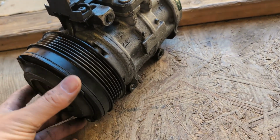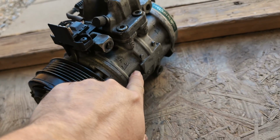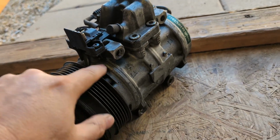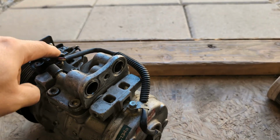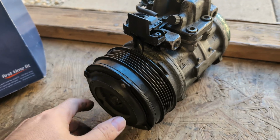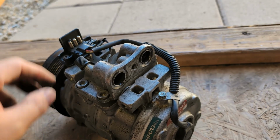the clutch from engaging. Because usually what would happen here is if it's not able to turn this the right speed, then there could be something wrong mechanically in here. And if this seizes, you're going to break your belt. And so that would be bad. So rather than having this fail and break the belt, it'll just let this free spin, clutch is not engaged. So that's one possible problem you can have, and that would stop the clutch from engaging. And then the way you could troubleshoot this is you turn your car off, turn it back on. If the AC works and it's engaging the clutch, then you know that your speed sensor might have a problem. And that was exactly the problem with my 300D.